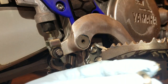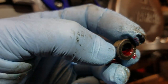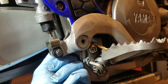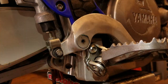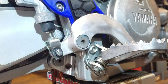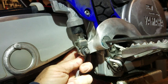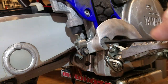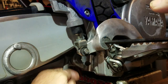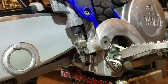Now I'm going to take that little 10mm nut and put Loctite in it. I'm going to put quite a bit — I don't need it coming loose. I would put it on the threads of the bolt, but it's really hard with the swing arm in the way. It's tough to get the Loctite on the actual bolt, but you can get it on the nut. Let me take these gloves off — I've got Loctite all over them. So I've got the nut on the back side. Just take a wrench and hold it with the Allen and tighten it with the wrench — that's how you get it really good and tight. Don't use the Allen for all your twisting when tightening because you're more likely to strip that out than the nut on the back side. The wrench has a good bite on it. Put it pretty snug because you don't want this having any play at all.